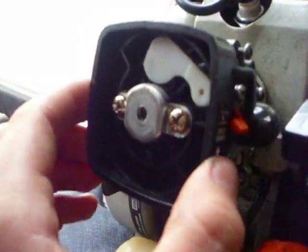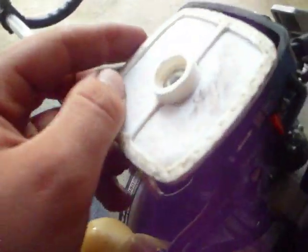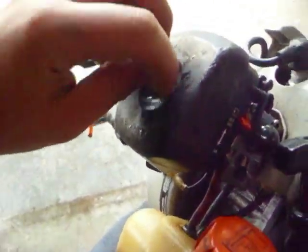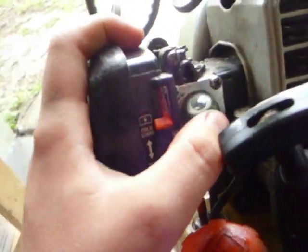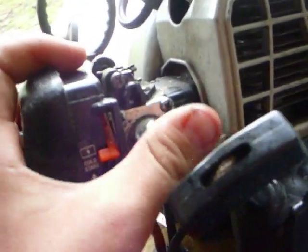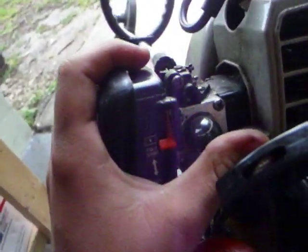Now, if you had to loosen it — which I did — tighten your air breather cover. Put your air filter back on, followed by the air filter cover, and just screw that back in. As you can see, the primer bulb works good. It primes up fuel how it should, and it actually might prime up more fuel than the old one did because it springs back a lot better.